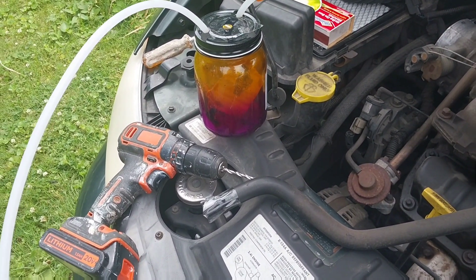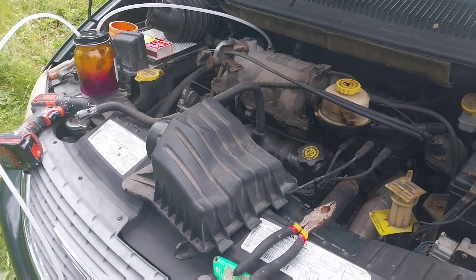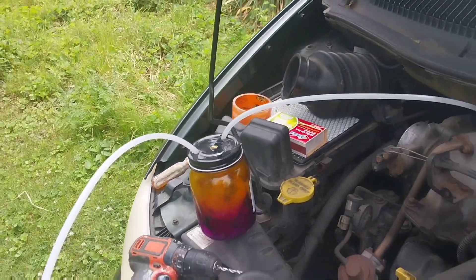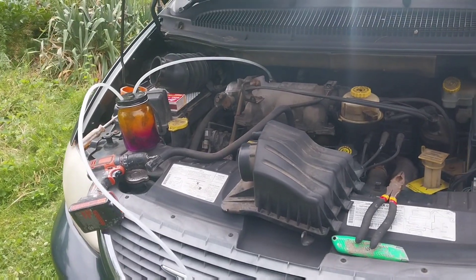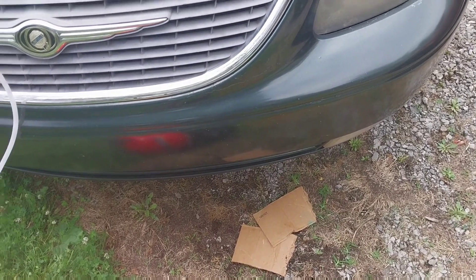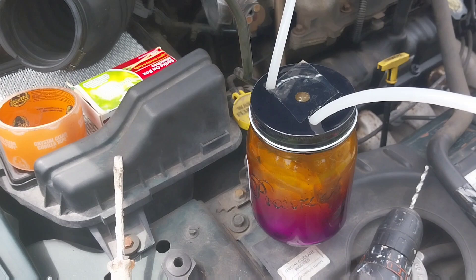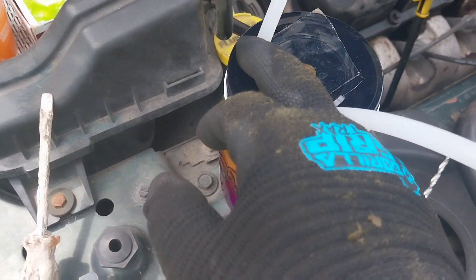The whole concept is you want to shoot smoke into your engine so you can see where it's leaking, because it's air and the only way to see it is with smoke. First thing I tried was flammable liquid on the wick — that didn't really work out too well, kept going out, not enough smoke. So then I got to thinking — cardboard smokes! If you haven't built a fire in a fireplace, cardboard smokes. So I took a bunch of cardboard and jammed it down in there, as you can see. I drilled one hole right here and one right here, then cut the holes in half.